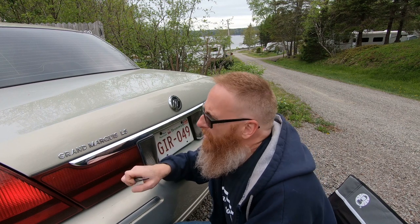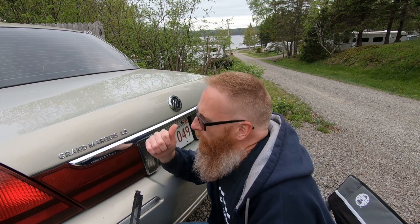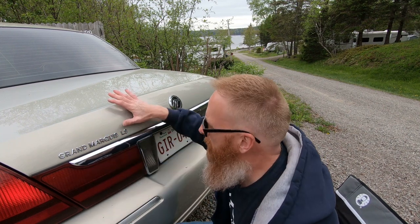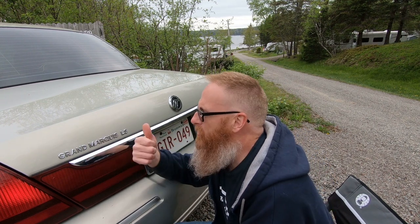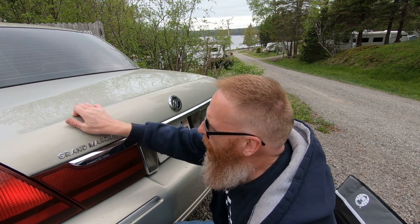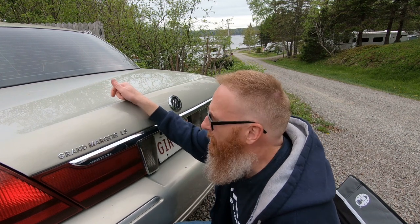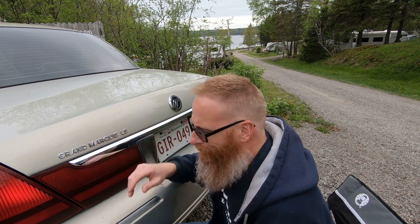Now that we've got that off, we're going to continue taking the rest of these letters off and then the transformation will be done. One of the tricks I use is brake cleaner — it will soften that adhesive right up so you can just give it a rub and it goes. With a little extra elbow grease you can use your thumb and roll it off. It's been on there for 15 years so it's stuck on pretty good.